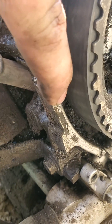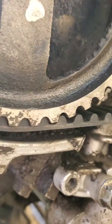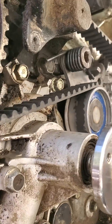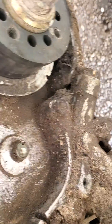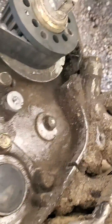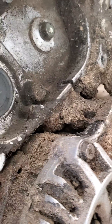Right here is a tab. I did not have anything on the gear other than a dot from somebody that had previously worked on it, and a spot on the gear right here which has a little bit of white paint. Down there you see the notch on that back plate — it needs to line up over here on the housing. There's a notch right there.